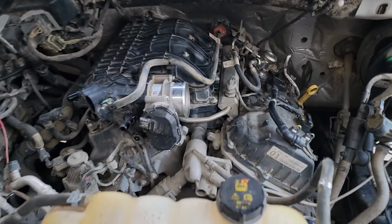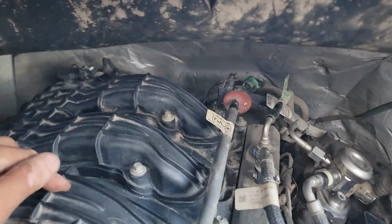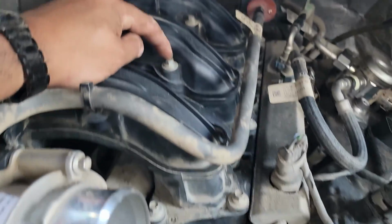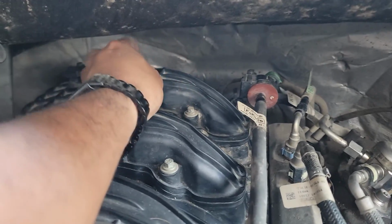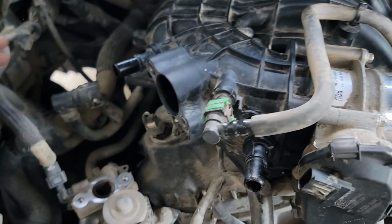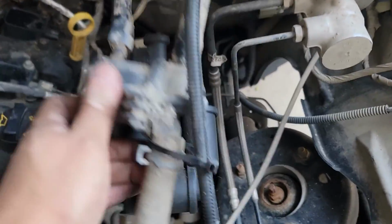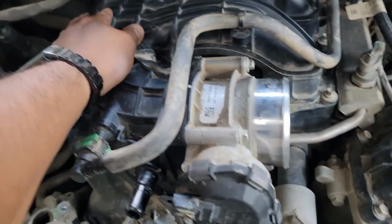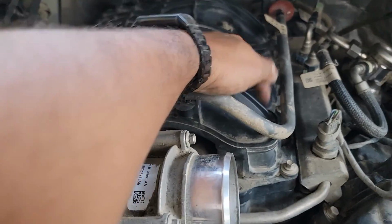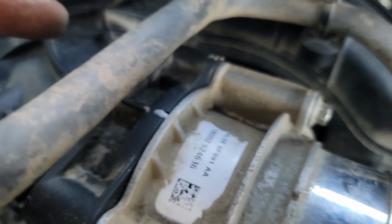All right folks, just threw the manifold back on. Started with the bolts in the back. Remember, there's 8 of these 8mm bolts going all around for the intake. I reinstalled that plug. There's some plastic clips, like these things over here that just snap into place like this. I'm reinstalling hoses right now. Manifold's on. We replaced the seals. You saw the one that goes here, and the throttle body seal. You can kind of see it sticking up right there.